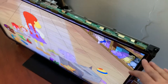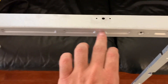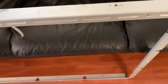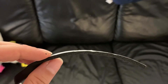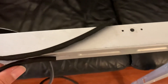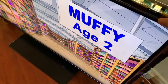My thoughts are that to fix this — this is the front bezel — we have these little depressions in the front bezel, and I believe that these depressions are the ones that are supposed to press those chips, maybe something like a heat sink. So my hope is that I'm going to grab this — it's just a weather shield I use to fix doors — and I'm going to put it at the back of each of these guys. Then as I fix it back on the TV, it's going to press this and get rid of the problem.